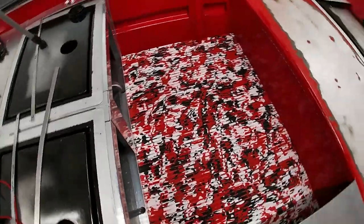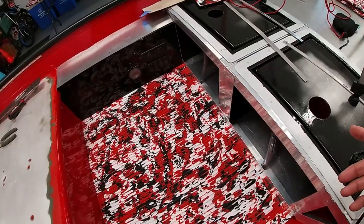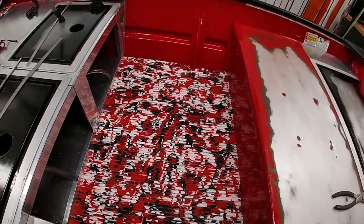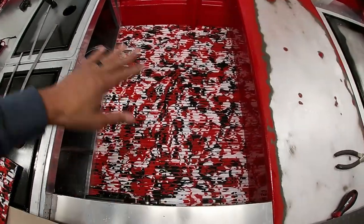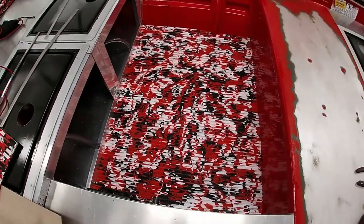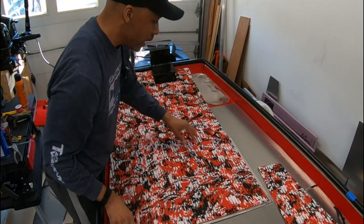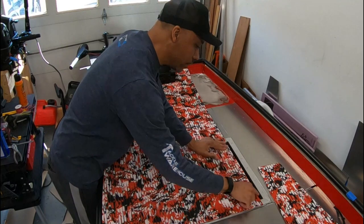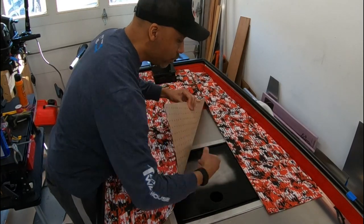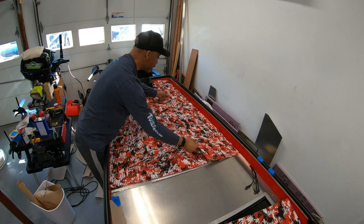Mission accomplished — first piece is officially in the boat, very stoked about that. I had to do a little bit of freehanding just to get the edges right, which you always have to do when laying turf. First impressions are really good — it does lay flat, completely flush, no bubbles, no air bubbles, no lumps. The 3M backing is pretty good. There is an extra charge for 3M backing for the hydroturf and it is a pricey charge, but in the end it's worth it. I have two pieces for the front — I'll be laying the big piece first, and the goal is to line it up with the edge of the hatch lid to limit the amount of joint I'll need to make when I lay my second piece.